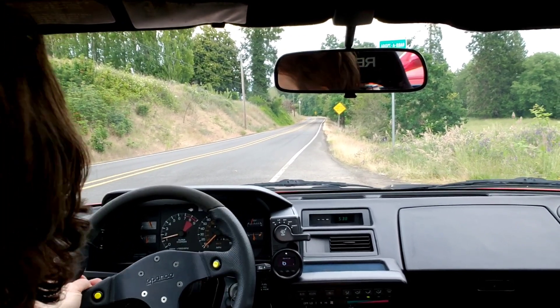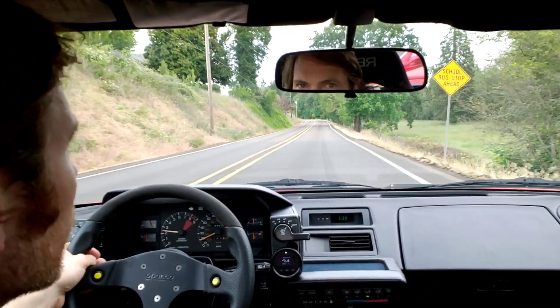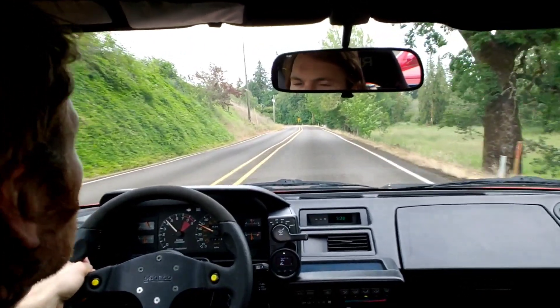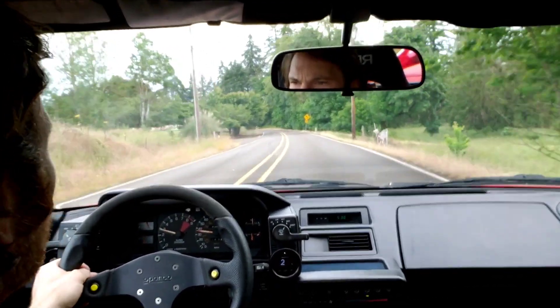So let's show what a rain setting looks like — it's going to have a very low slip angle, so you can hear traction control kick in relatively quickly. If I roll in on second gear, you hear the banging and the popping — that is all coming from the traction control that Motec is using.